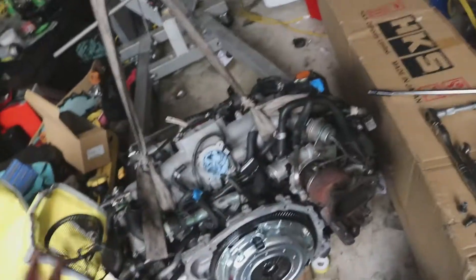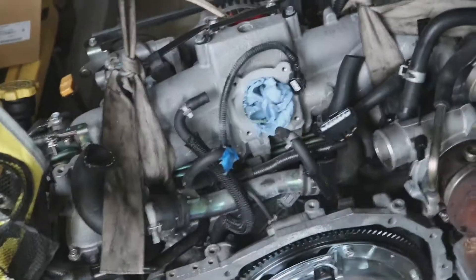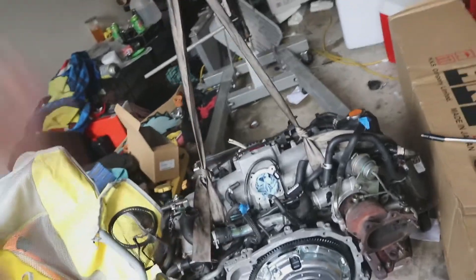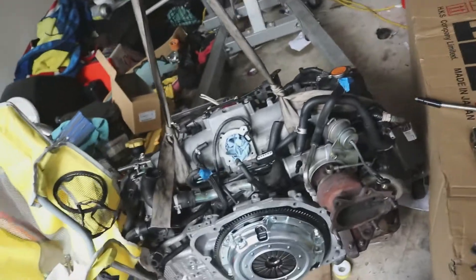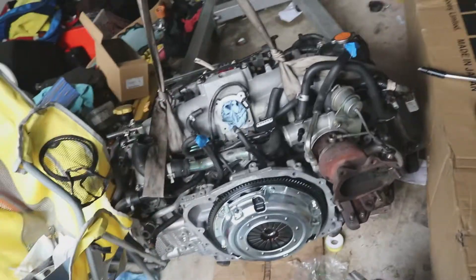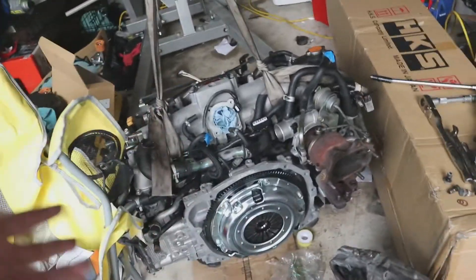I went ahead off camera and did a little bit of work. We're going to put the transmission on tomorrow, but I went ahead and pulled the stock throttle body because it was drive-by-wire. We're actually converting this whole harness to a drive-by-cable setup, so instead of the big bus plug we're using an actual throttle cable. That requires us to take the intake manifold off so we can unplug everything and fish it all out the right way.